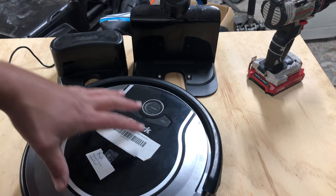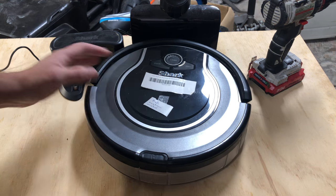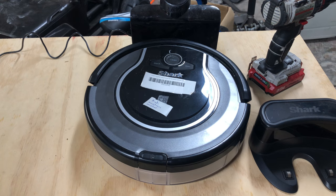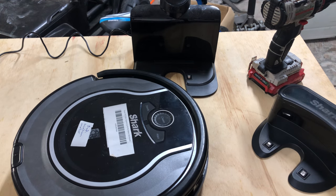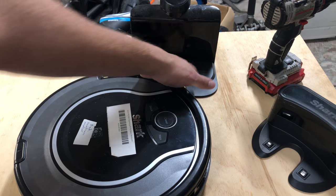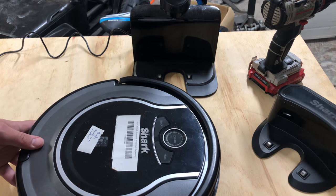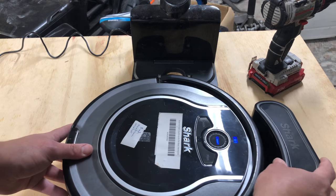It's not that — what could it be? Could be a solder joint, could be the motherboard, it's completely dead, or it could even be the battery not charging. But generally if the battery is charging, when you go up on it it's going to show you the blinking lights. Let me go ahead and plug one of these in — I'm going to do a single charger just because it's got a longer cord. Green light's on. If you come down to this step and you can measure off of these prongs and you're still not getting anything, go ahead and try to manually put it on there and wiggle it around.